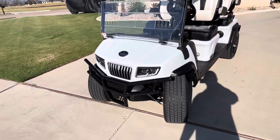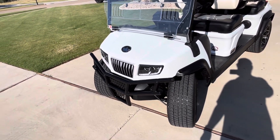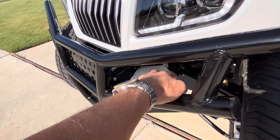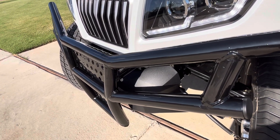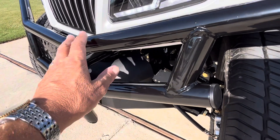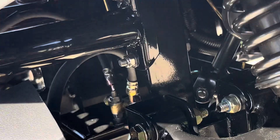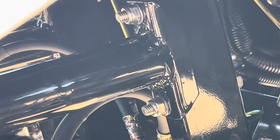It's a very easy install. You'll need to take the bumper up front and lower it — there are some bolts behind there. Just put them on the middle or the top bolt, which will lower the bumper down, and then the brush guard will bolt in perfectly. You can see those two bolts there, one at the top and one at the bottom. Those holes are already there.